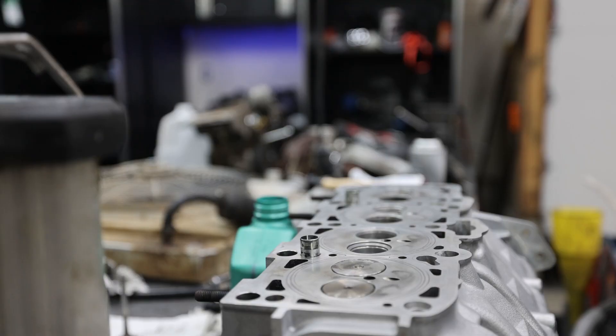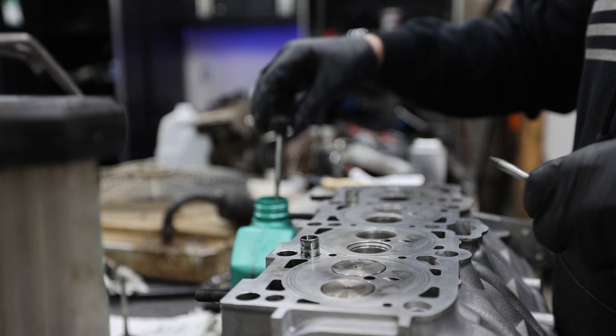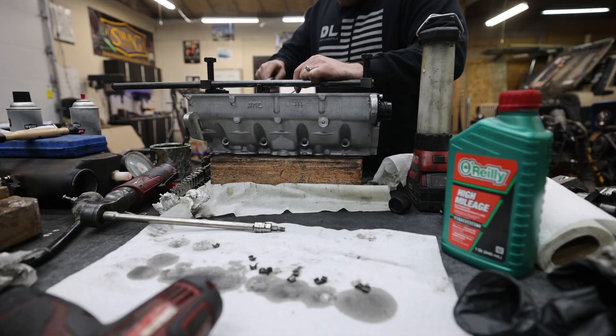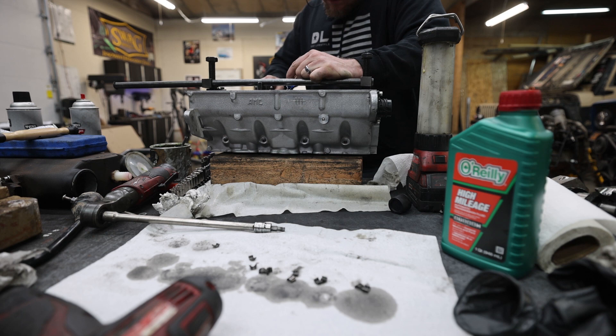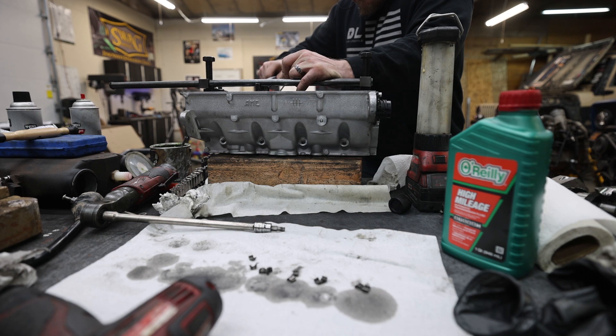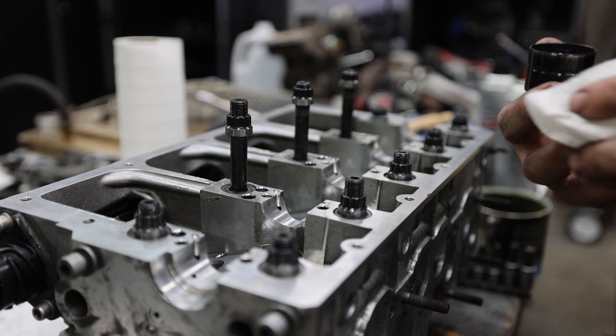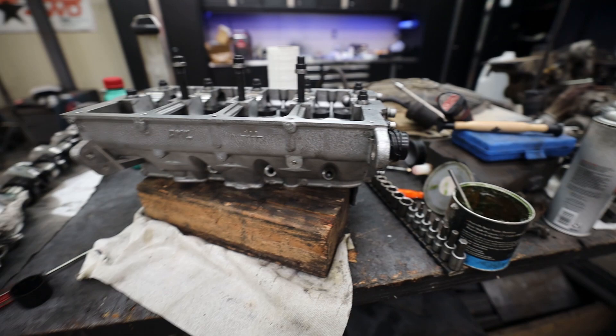I don't feel comfortable assembling engines dry, and that comes all the way down to just putting the valves back in the head. I prefer to use automatic transmission fluid as assembly lube. It burns off very clean, mixes very well with oil, and especially with diesels — with an old school diesel you can run it on pure ATF. So this is my assembly lube of choice for a thin lubricant that will burn off easily. I also have a special device to magnetize any screwdriver, and when you're installing these valve spring retainers, it's so much easier with a small magnetic screwdriver — especially with just a little bit of grease on the inside to keep the retainer from coming back off.